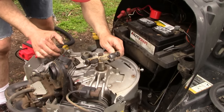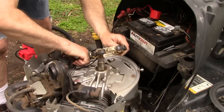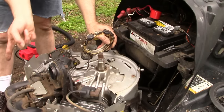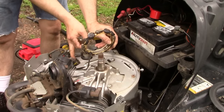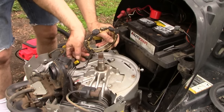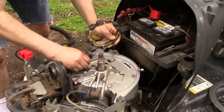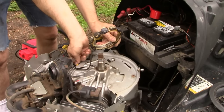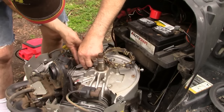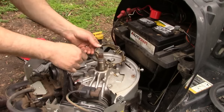but I suspect that possibly, and this is pure conjecture, but I know that the headlights on this thing, the wire that goes down to the headlights that runs past the muffler, that wire melted out and shorted. I wonder if something like that happens, that this stator could get kind of chewed up, burned out. I mean, it was putting out some voltage, right? There we go.